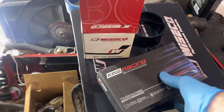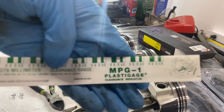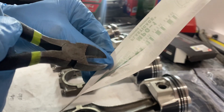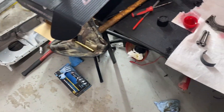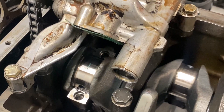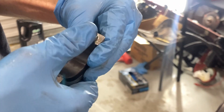Let's get our bearings out and hope they're in good condition — I got a pack of bearings recently that were everywhere. Let's go ahead and plastigauge and check the clearance. Get a little strip out, and I'll show you for the next ones how to line it up: set your first ring right at the edge, then the secondary ring — that's what helps jam it down there. Place the cap, do this without any lubrication — it's the only way to really tell.